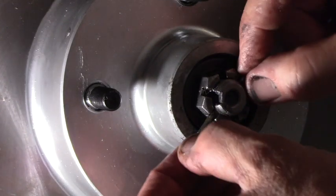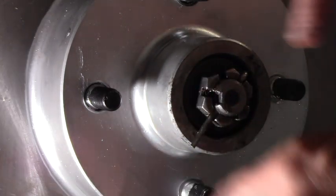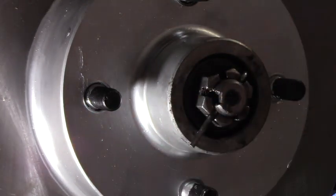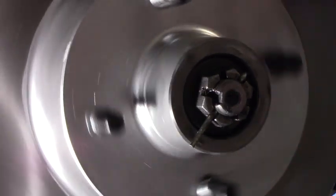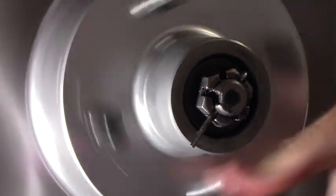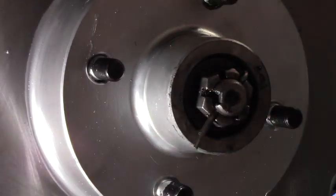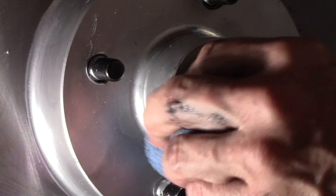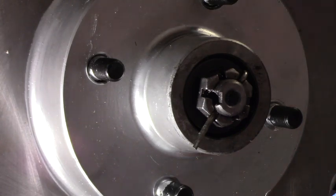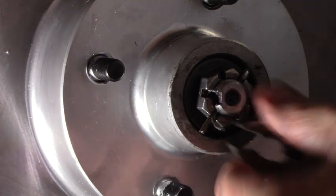On airplanes, everything crucial is wired. Parts around the engine all have this safety wire going through them to keep the bolts from vibrating loose. You see? So that's nice and tight. It's turning smoothly. Nice fresh grease in there. Brand new meaty rotor. And you can check it for play, jiggling it back and forth, that's fine, a little bit's good. Like I say, you'd rather have a loose bearing than a tight one, because a tight one could be ugly. Okay, now we just bend this little guy, whoop, like that.